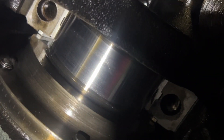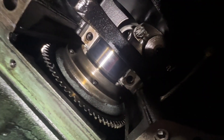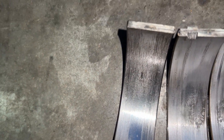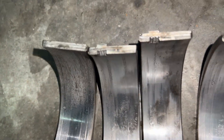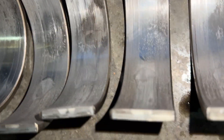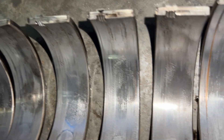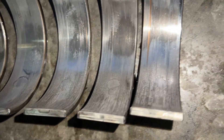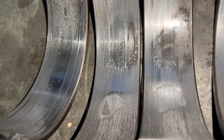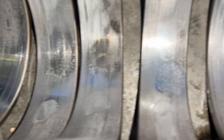Here's another crankshaft journal — this is the one with the thrust washers on the end. Thrust washers are in good shape, that's really nice. That's the main bearing. That's all of our main bearings in order. Number one was by far the worst, but none of them were horrible. The engine didn't die from old age — it got overheated, and that's what the problem was.